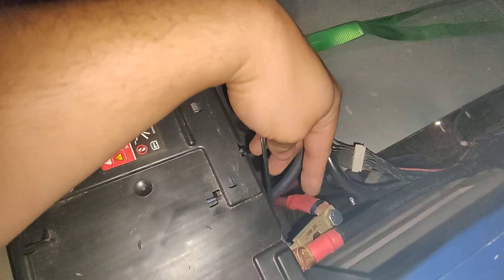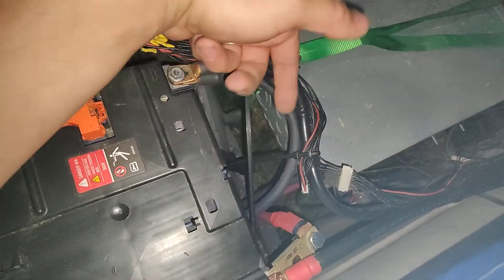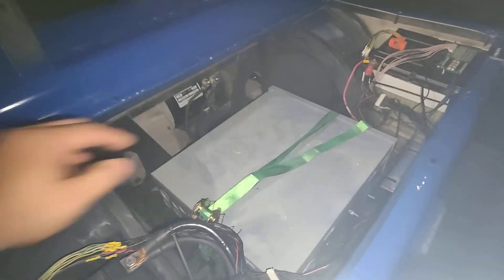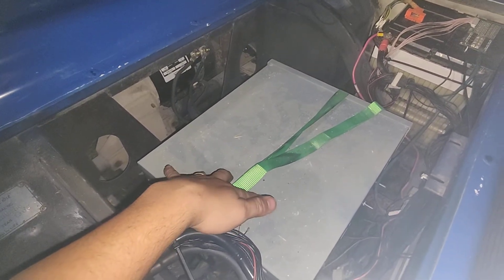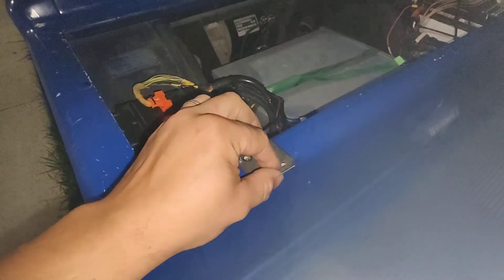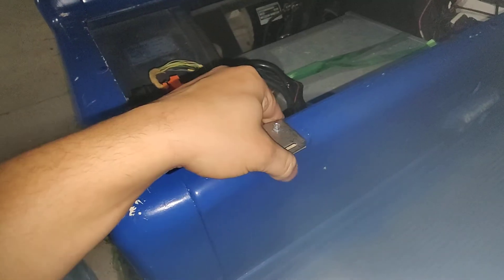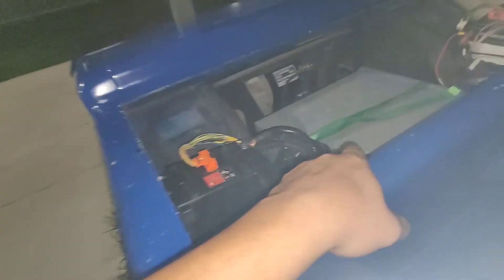In line with my fuse right here — I have the fuse right off the main input going into the box. That's my positive lead; if that pops, everything just turns off. I'm not going to open the box because I've done that in other videos. There's an Altrax controller in there, a reversing contactor, and two buses for 48-volt leads to my switch. I did convert it to a reversing switch instead of the older style lever system, which was actually missing. I also had to replace the seat latches with EZGO-compatible ones because the originals used a pole sliding system I couldn't find anywhere.